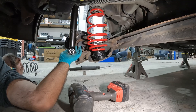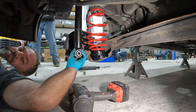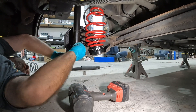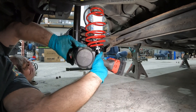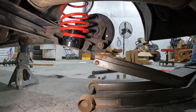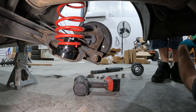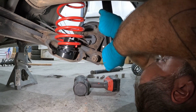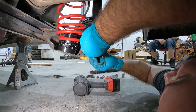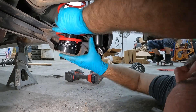Skippy's putting the nuts on the top of the shock while I'm holding it in from below. Now they're jacking the swing arm up on the other side so we can get this shock lined back up. We move to the other side and do the same thing — move the jack to the other side, put the shock in at the top, jack the swing arm up again, put the shock on, and we're done. These are super simple.